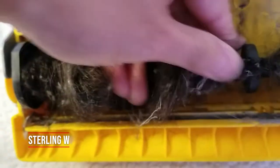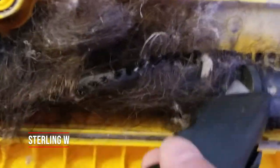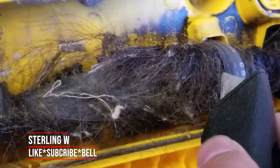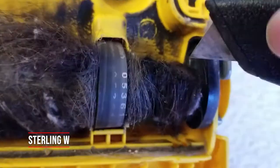I already have it here so I can slowly pull off most of this hair first before I take it off the vacuum and take the belt off too, so I can get underneath the belt. Anyway, just slowly work it one section at a time — you can slowly pull the hair and clean up all the hair particles. If it's like a wooden roller, you can still do the same, just be careful because you don't want to damage the roller, the brushes, or the roller bar. And of course, don't cut that belt — that belt's kind of pricey and you don't want to have to replace it. Control your cuts and make sure you cut most of the hair off. Slip the blade close to the belt and pull away from it.